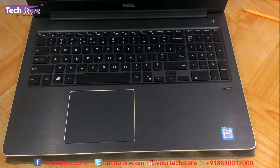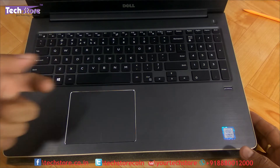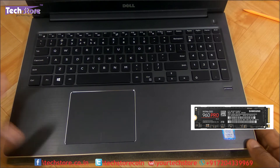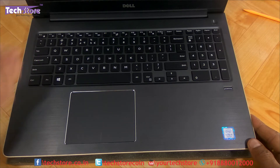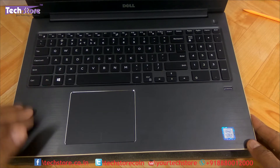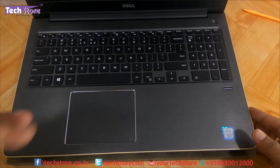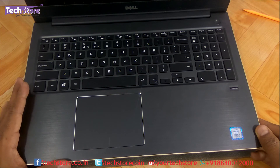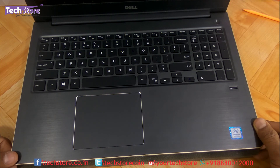In this video we have shown you how to replace the hard drive with a SATA SSD, and also how to install an M.2 SSD in the dedicated slot. You can upgrade the RAM up to 16GB per slot, giving a total of 32GB maximum. We also showed how to replace the battery. Everything is easily accessible once you remove the base — a fantastic design by Dell in the Vostro series. Hope you liked the video; do let us know your suggestions and comments, and don't forget to subscribe. Thank you for watching.